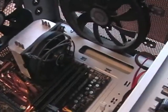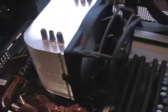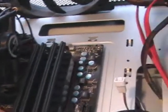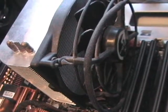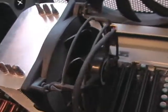Another thing you want to watch for is your heat sink. In between all the fins it collects a lot of dust because the fan is sucking air in, blowing it across and out the back. While it's doing that it's also sucking up whatever dust is circulating throughout your case, and a lot of that dust doesn't make it all the way through — it actually stops and builds up right behind your fan.